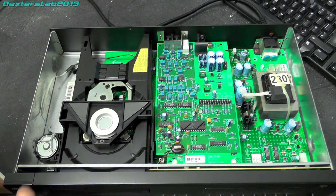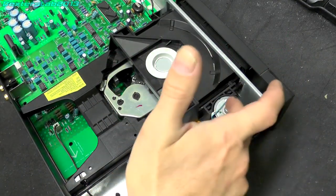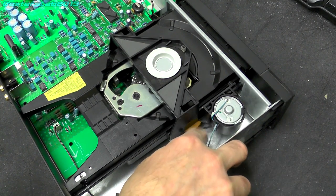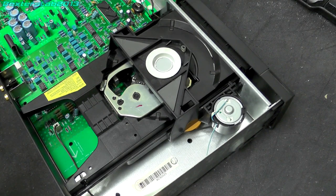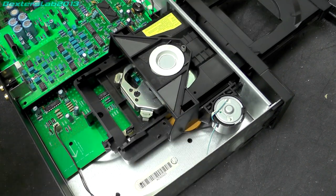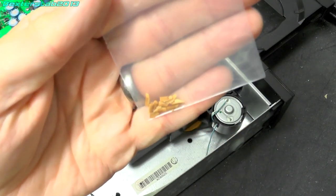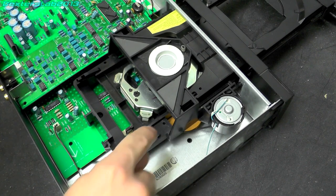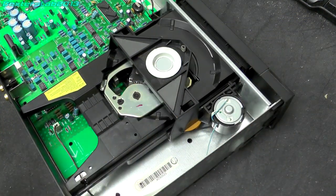What we need to look at is the CD mechanism — let me whizz this round to show you. Here we can see the CD section; there is a small motor over here which provides the tray eject and load function. There's a small rubber belt drive and a gear wheel, and that is where our problem lies. If I try to eject you can see it doesn't really do anything and I don't think it's attached to the gear at all, because inside the case when I opened this up I found all the teeth from the gear. The teeth have just been ripped off — broken off because they've gone brittle. So we need to take out the CD mechanism to get to the underneath and change over that drive wheel.